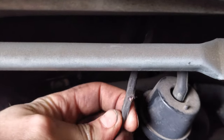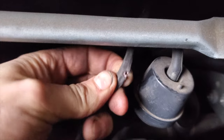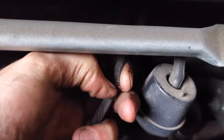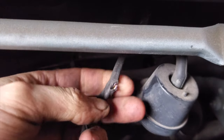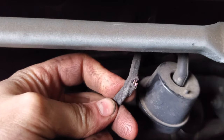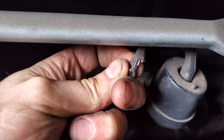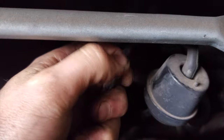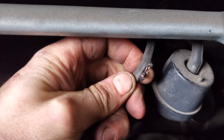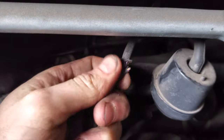It's going to be tricky to solder that — I'll have to put a connector in there. That's good though. I'm going to strip that wiring back because where there's one damaged wire there's usually more than one. I don't like just patching wires — I like finding all the faults because where there's usually one wire about to go, there's usually a second. I'll put the camera down and have a look.